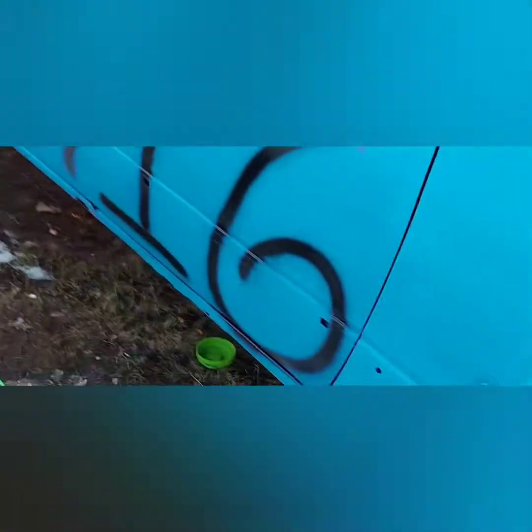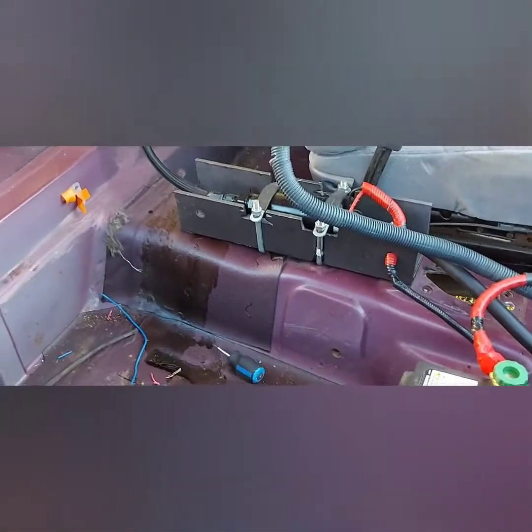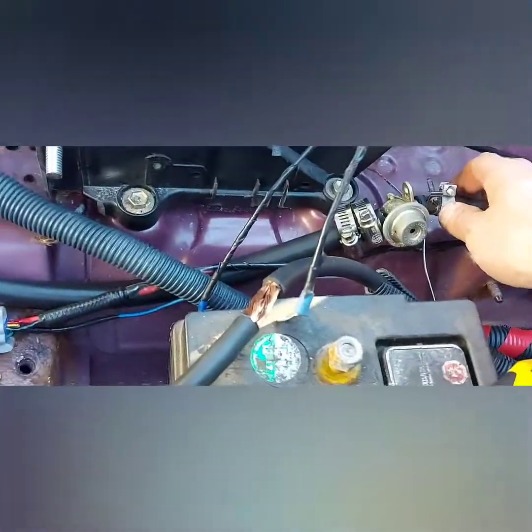Still haven't gotten it to run. I know the engine is getting fuel — there's pressure in line right to the engine. I tried a second standalone harness, that's not the case either. I'm down to the last couple things: either my computer is shot — might be gone for some reason — or this fuel pump is putting out too much fuel pressure for the engine. I do have the stock Camry fuel pressure regulator in there but I'm not sure if that's working right.